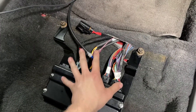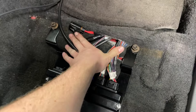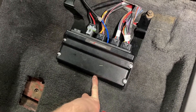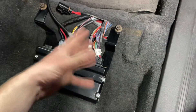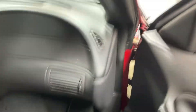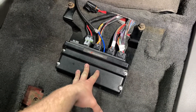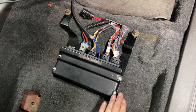Because I have 2013 Mustang seats in here, and it does have a bar that goes across, I'm going to have to unplug everything, lay it back, throw the seat in, and then put everything over top of that bar. I think you guys can pick up these brackets for right around 90 to 95 bucks on Holley's website. For me it just seemed like a simple, easy way to go. The Terminator X Max is a lot wider than the Terminator X, so there wasn't really a whole lot of options underneath here and in that fender well. If you have just the Terminator X system, it's probably a lot easier to put it in other places like that wheel well, but for me with the Max it was just easier to put it underneath the seat.